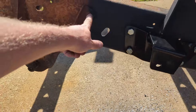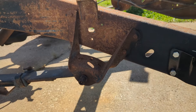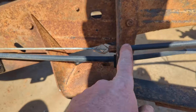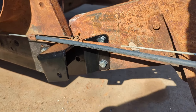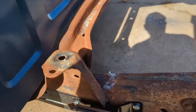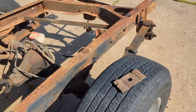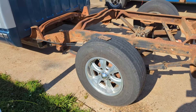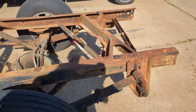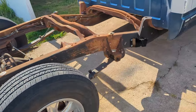After I get that moved, I got to cut all these off and get rid of that. You can reuse this if you're not trying to lower the truck — if you're lifting it, it may come in handy. I got both sides on. This side does have an e-brake bracket; I didn't put it on yet. I'm going to have to pull all this back off, paint the frame and everything. Once I figure out where everything's going to go, I'm guessing I will order short bed e-brake cables, although I'd really like to do a disc brake conversion at some point. We can now move the leaf spring forward and figure out where the leaf spring hangers need to be.